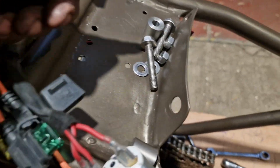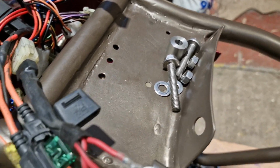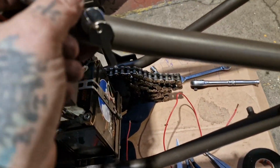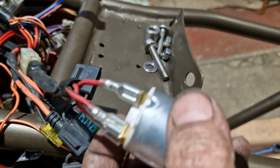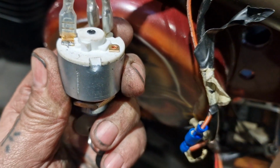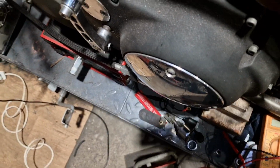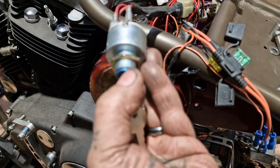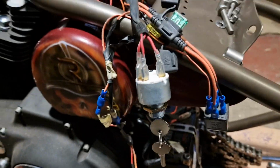So I've took the rear, those nice stainless ones you saw me do a voiceover about. I've had to set them off so I can wriggle and tiggle and fuck about dropping the tank down a bit. The lighting's awful. To get the old switch out, and we've soldered some spade ends on with some silicone insulation and modified. We've took one connection clean off. This ignition switch works on 3 positions, so it's off, then on, which it is now, and then you can turn it again for a starter, so it turns and clicks back like. We're not using that function, we've got a button underneath, haven't we? Yeah.